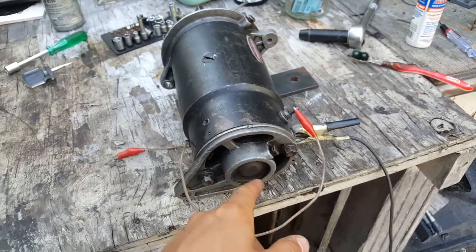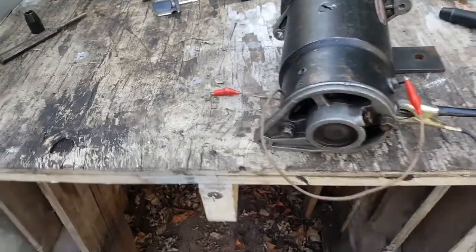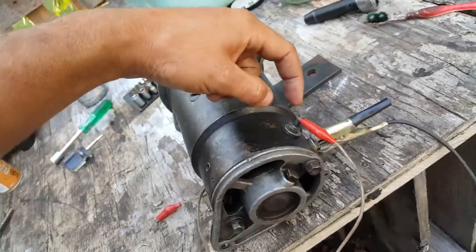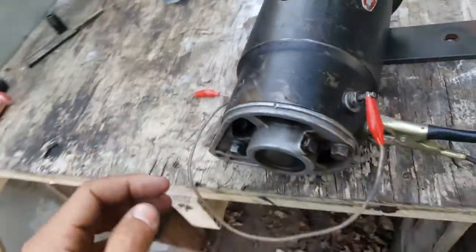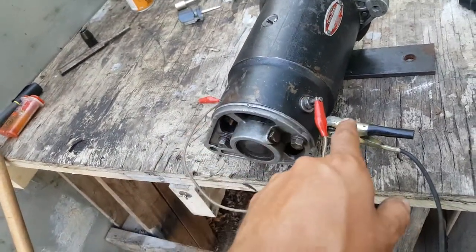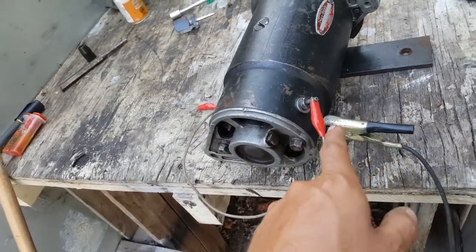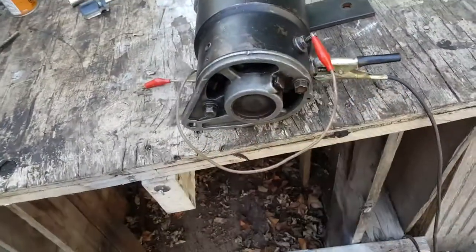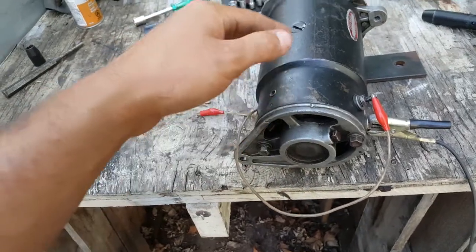First thing you have to do is check for insulation — make sure it's all right. It's not a difficult test. By following this circuit, I've seen some people jump a wire from here to there, but that's wrong because these are opposite terminals. Remember, this is an electromagnet. In my previous video I showed how we have to connect one terminal here and the other terminal there.